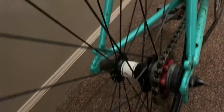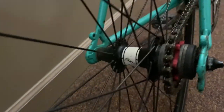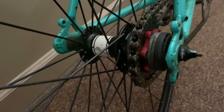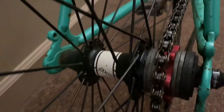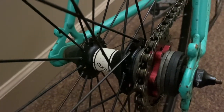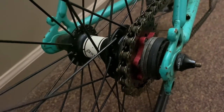I thought about a few things on my ride back that I didn't really mention. See this back freewheel adapter to the single speed? If you just throw a gear on there, which you can do, it'll just shred because it's too much torque in one spot. So this red plate is on the inside and the outside, and it makes the gear a little bit thicker, so it has a little less bite into where you put the gears on for a freewheel or a cassette.